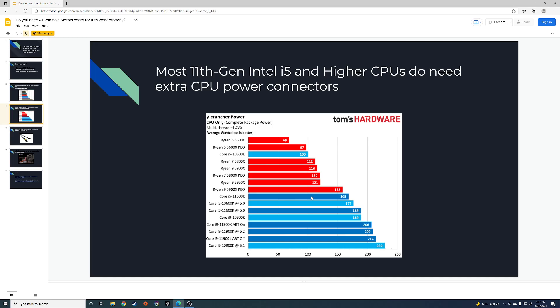But if you're running something like a Core i5-11600K, you're going to need the 8-pin and a 4-pin populated to provide enough power. Even if you use a Molex adapter, you can probably get 54 watts from it, plus 150 watts from the normal 8-pin, putting you at around 204 watts — enough to power a Core i5-11600K overclocked to 5GHz pulling 189 watts, or a Core i9-10900K.